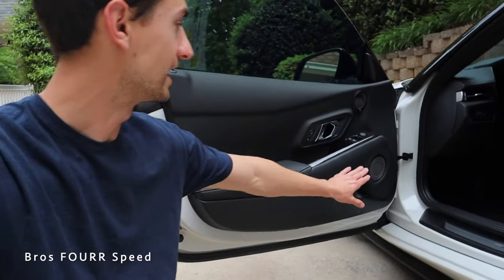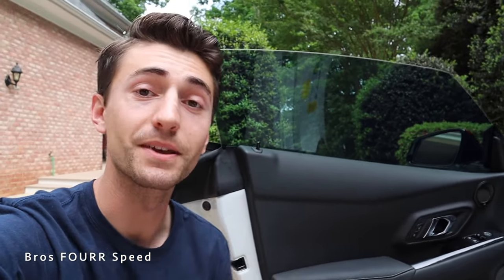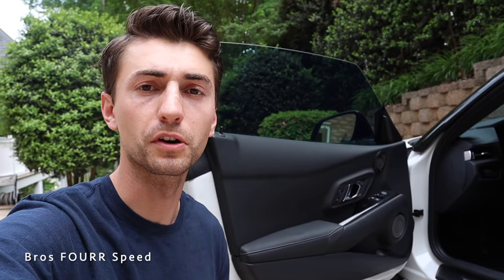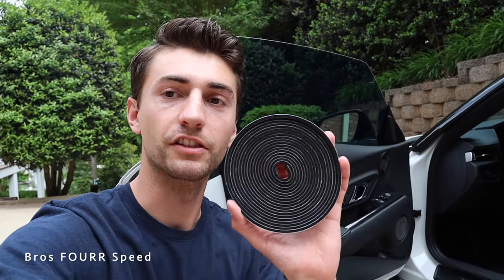Hopefully that picked up well enough on camera to give you the idea — it is just so annoying. No matter what I do, I always have to put my knee against this panel or press my elbow against it from the armrest to make the rattling stop. So in today's video we're going to show how to fix interior rattling in your car. It doesn't have to be just a Supra — my GTR's steering column rattles a little too. What I ordered from Amazon was about $10–$15: basically a piece of foam with adhesive on the back, made for home doors.